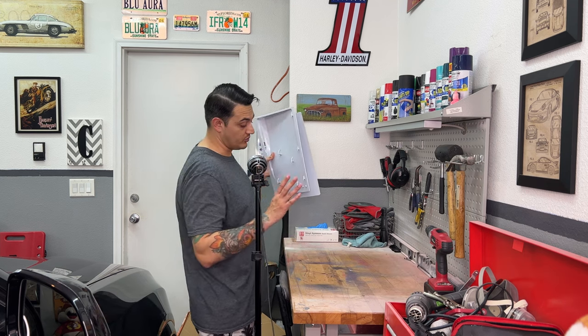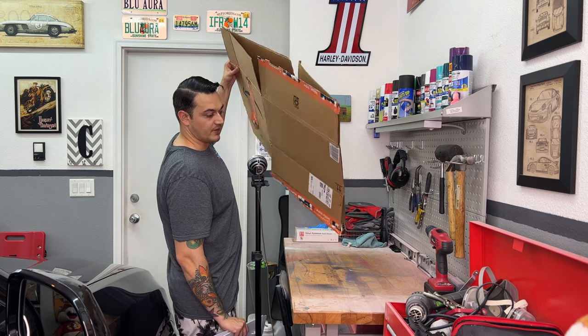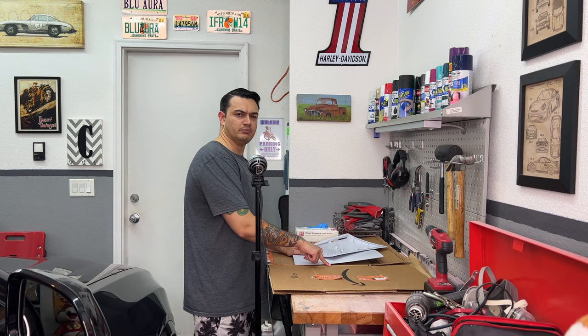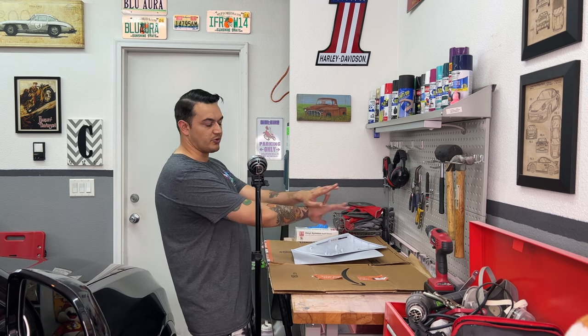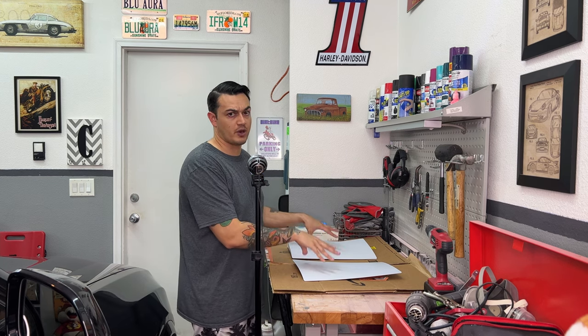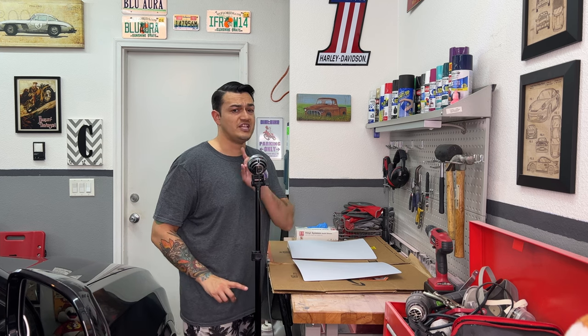Sorry about the audio quality — who would have thought that a non-acoustically treated garage would sound like this? First thing I want to do is make sure I don't destroy my workstation more than it already is. Step one: cardboard your workstation. Step two: move your vehicle out of the garage so you don't get overspray. We're using black paint and this is a black car, so I don't care about the overspray. The spritz pattern is going to be well contained. Now, the people that complain about spray painting don't know what they're doing. There are three key takeaways to make sure your spray paint job actually looks good. The first one is prepping the surface — you do not need to sand this, it's already rough and porous.